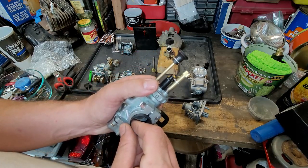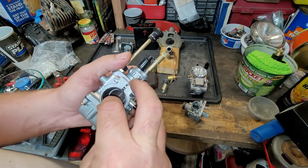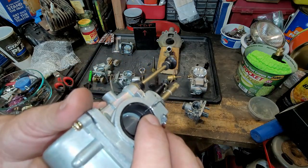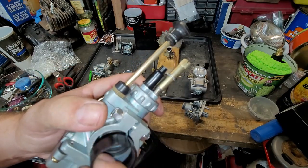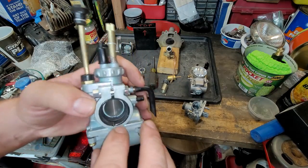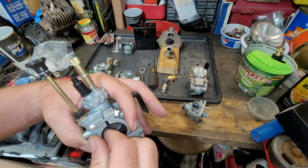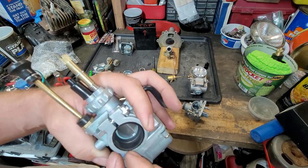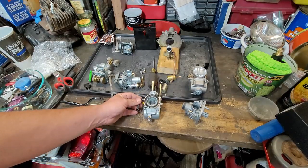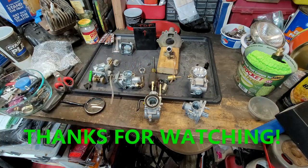This also has a good quality seal — it's got an O-ring style, it's stepped, and then there's the insulator ring. That part's cheap but it does work. When you're doing these insulator rings — see how that's lined up with the crack? Never do that. You always want to offset this, because you don't want to suck air there. Offset it, put it down bottom or off to the side — it will clamp down either way, but do not line up your insulator with the seam. That's not good practice. Alright guys, I hope that helps you with aftermarket carburetors — thank you for watching, thank you for subscribing, and if you have any questions please ask. Talk to you later.